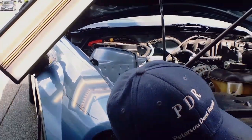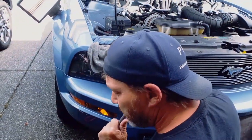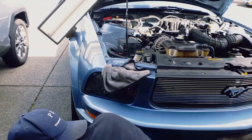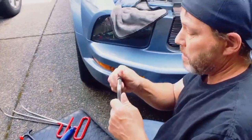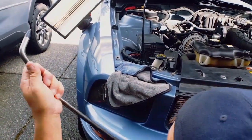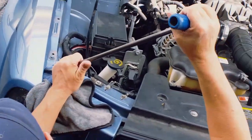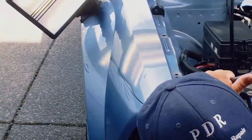I'm going out to the outside edge and going to kind of sew up this little line. I'll give it a little bit more angle on the tool so I have a little bit more to push on. This big soft tip is great but it's not what we need — I think we need a little bit more dialed in, sharper tip. I'm going to go with tip number E2-P from Dent Craft — not a sponsored video.